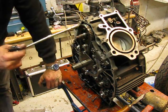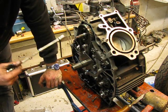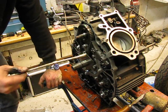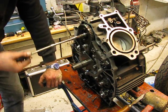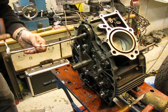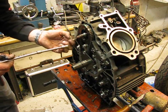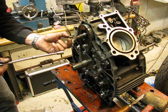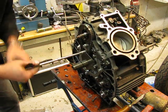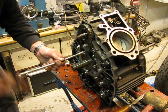The distribution chain has to follow a path, and Honda made that path with tensioners, plates, gears, and cogs. I can see already — this one is not good installed. Look, this bushing has to be at the other side. And that was not tightened on. Strange.